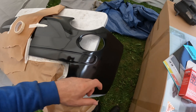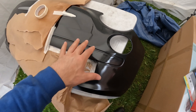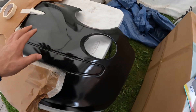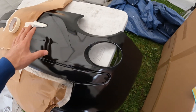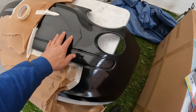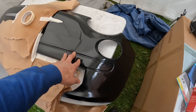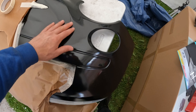In the end I did two much thicker coats, and then the third was a lighter coat to try and end up with about three coats of clear coat. Even just from spraying on the extra layers it already looks a little bit smoother. I've let this dry now for a good few hours. What I'm going to do now is just wet sand this whole thing down and see if any of this orange peel comes out.